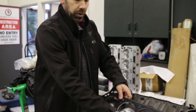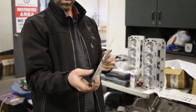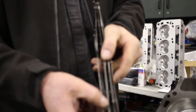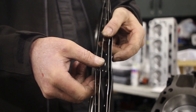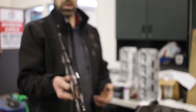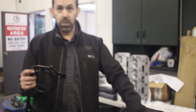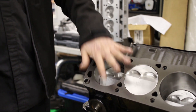We're using Cometic multi-layer steel head gaskets — MLS stands for multi-layer steel. Each layer is a thin sheet of steel with Viton rubber impregnated into the layers so it seals properly. These gaskets are commonly used on turbocharged engines because they're much more resistant to detonation and very durable. However, the surface of your engine block and cylinder heads must be at the correct surface finish — finer than you'd need for a fiber gasket.